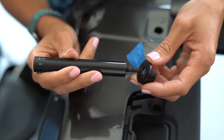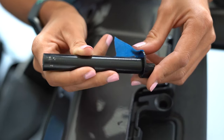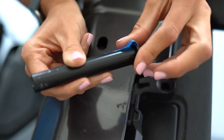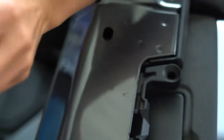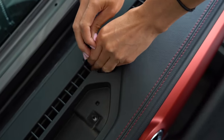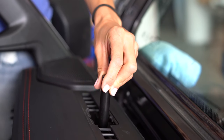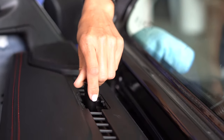The passenger side has a special standoff washer that goes on the bottom of your standoff. It's easiest to tape it on there until you get it started, and then lower it down into it. On the driver's side, there's no standoff washer, so just thread it into the hole.